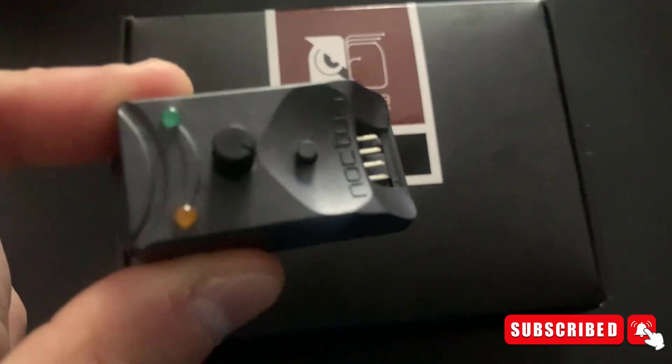It's pretty easy to set up. We have the existing fan controller here. What we did is we've taken the controller, attached the SATA power input to it, and then the output signal — hard to see, apologies — the output signal now runs into the control input on the actual fan hub. I can turn it up or down by using this knob here. Right now it's at the slow setting — I can turn it up now.